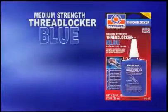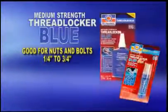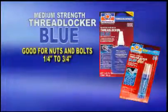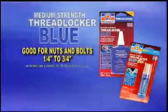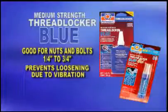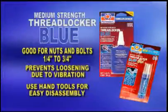Permatex Medium Strength Thread Locker Blue is a multi-purpose medium strength thread locker. It's ideal for all nut and bolt applications 1/4 inch to 3/4 inch. It eliminates the need for stocking expensive lock nuts and lock washers, and locks and bonds while preventing parts loosening due to vibration. Medium strength thread locker Blue protects threads from corrosion and is usually removable with hand tools without having to apply heat.